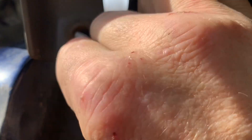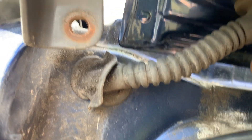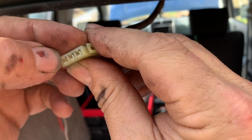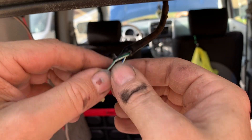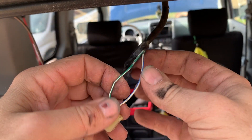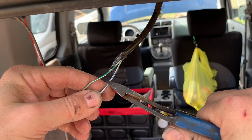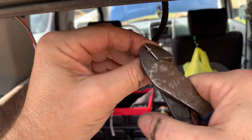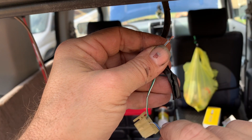Put the end of the boot back in — just work that around, wiggle it around until it seats itself and it'll pop in there, it doesn't seem like it will but it will. Remember I said earlier the center plug is the one we're going after — the white wire, the one that has power on it, we checked with our meter. I'm stripping that back, I'm gonna cut this here and put a wire nut on it attaching our wire to it. I know, wire nuts — it's gonna work. Funny thing is I really don't use this light in the back; I keep it turned off because I drive around a lot with the tailgate open.